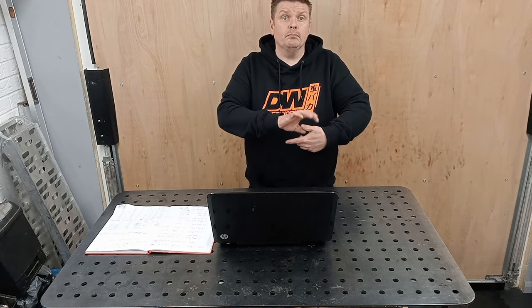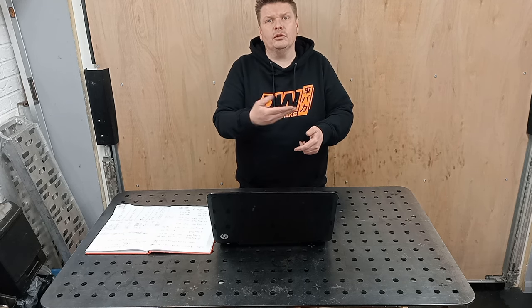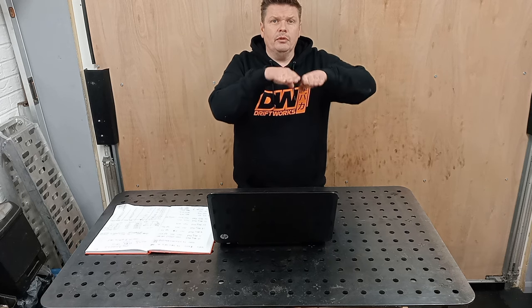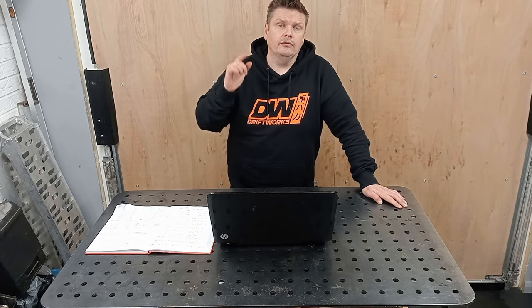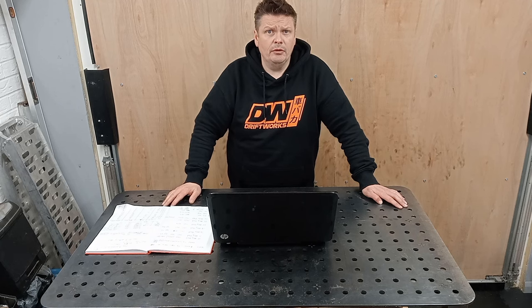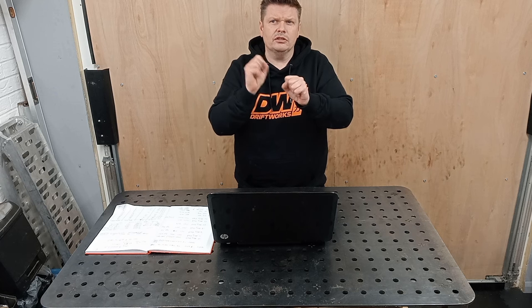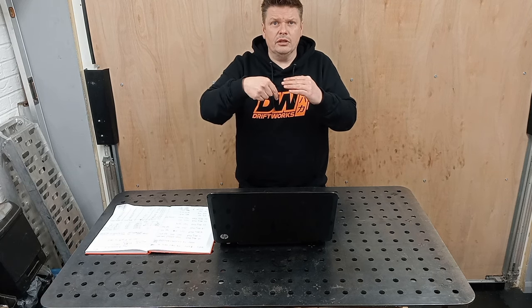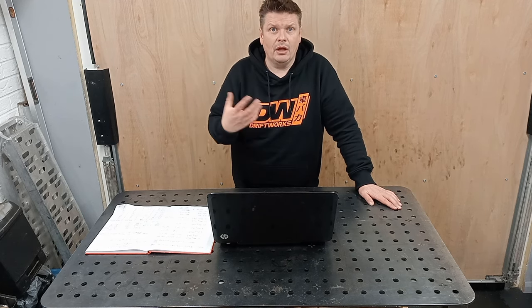Things I want to try next: a lot of guys have said single piston ring. I'm trying to get a piston — it's impossible for the 12mm piston pin, so I may just remove one of the rings, but then you've got a problem with the port communication. A lot of people mentioned I've dropped my corrected compression ratio, measured from when the exhaust port closes — the true rather than geometric compression. I've ordered some heads and I'm going to remachine them to bring it back to the 7.4 to 1 I had before. A few guys have also mentioned polishing — mirror finish. It's not really for flow, but it prevents heat getting into the metal. If you mirror finish your combustion chamber and piston crown, rather than the heat going into the engine it gets dumped into the exhaust, which feeds it more energy, which means better wave action and hence more power.